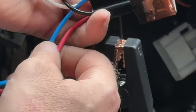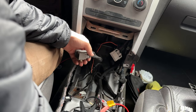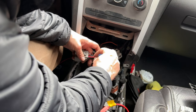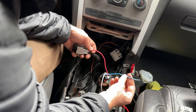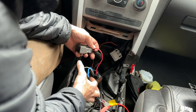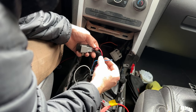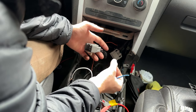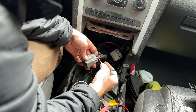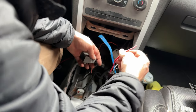The way you hook this up: we've established these wires are always hot, so we run a wire from there into the relay's red terminal. Then we have the output run to our light bar. When we flip the switch on the steering wheel, it makes the click and power runs from the relay out to the positive side of your light bar. Ground the negative side of the light bar anywhere and that turns it on. I'm not wiring it to an actual light bar in this video since I haven't bought it yet, but the click feedback confirms it would work.